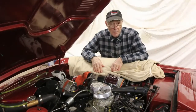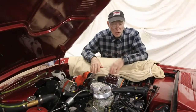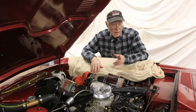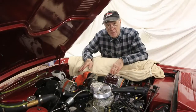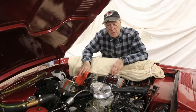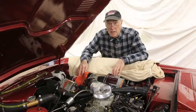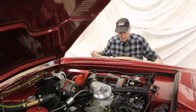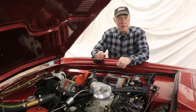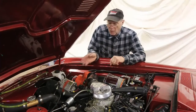Now we're going to run the car. You should crank the engine a couple of times without starting it — pull an ignition wire or use a cutoff switch if you have one. Let it crank over and that will prime the pump inside the supercharger. You don't want this thing running at speed without the pump being primed. Just a little trick that could save you a lot of money.